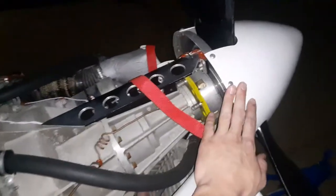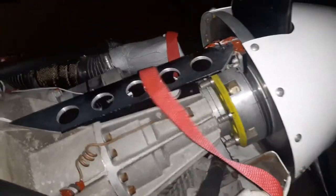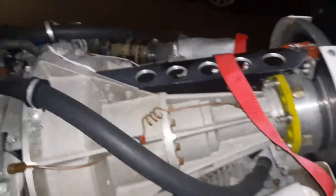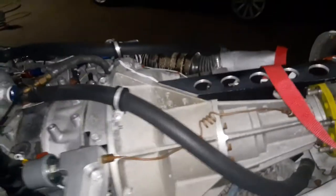You can check the end play of the engine, the end play of the output shaft on the gearbox, as well as bearing play and the backlash in the gears. That's very important with any automotive conversion or geared engine.